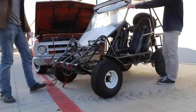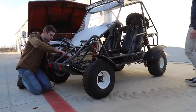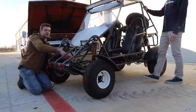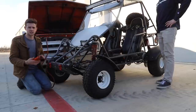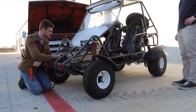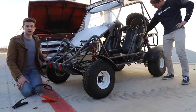Dude, could the battery start? So this is something I haven't seen before. When we hook up the jumper cables, it wants to start. So I'm thinking maybe the starter solenoid's like stuck open or something like that. Maybe it needs to be like cleaned out or something. Really not sure about that. We haven't had this happen before, but we'll let you know what that is.